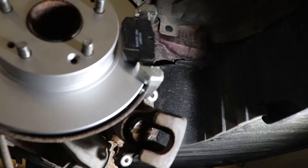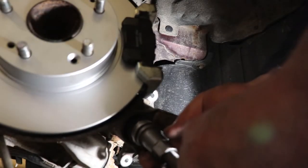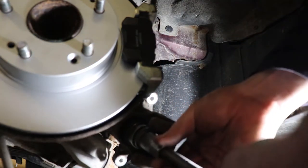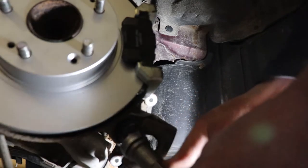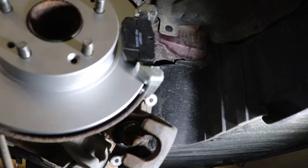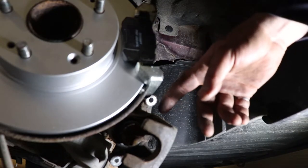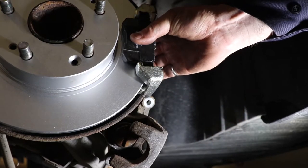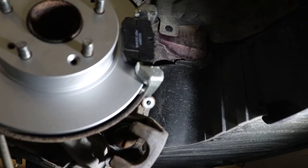Alright, so this is going to be the quick finale. You use the tool with the adapter, and you would put it in here, and if you had a good caliper, you would be able to wind it back into position. But this caliper is junk, it won't go back in, so that's why we're replacing it. But if you were just doing a pad job, you would turn this back in as minimally as you need to get it onto here, and then I think it would be self-adjusting after that. So, sorry for the quick ending to this video, but thank you for watching.